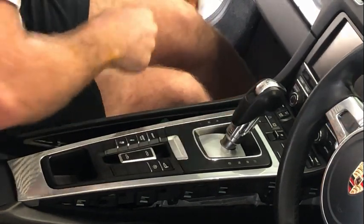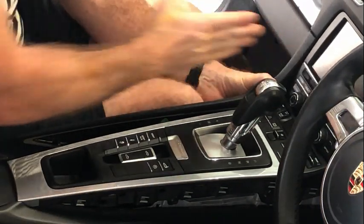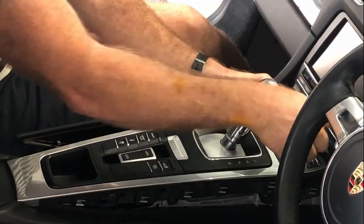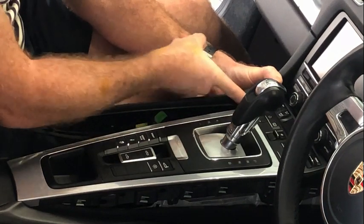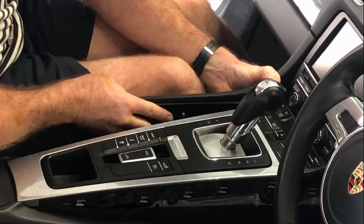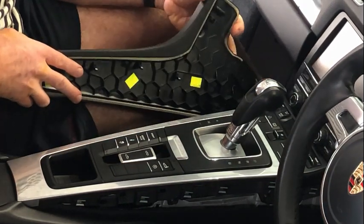And once they're all out, when you pull this out, don't rotate it up. You want to pull it perfectly rearward. Otherwise it's actually easy to break one of these little pins that goes down the side there, which I did on mine. So pull it rearward. You can actually look down the side and see the last of the knobs for the clips that you need to make sure is clear. And then you're just going to gently wiggle it rearward, and that'll just pop straight out.